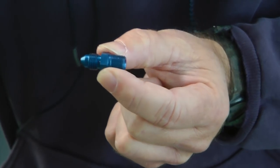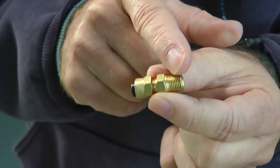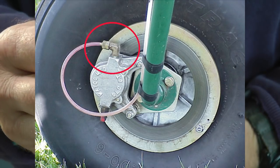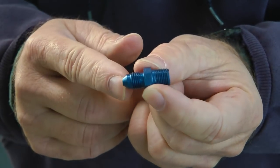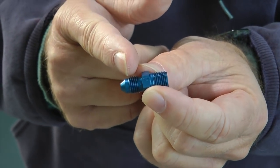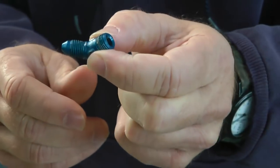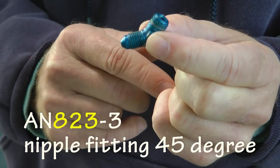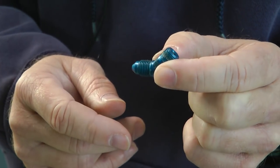The AN816 takes the place of plastic fittings — it has 1/8-inch NPT into the master cylinder or caliper where the plastic line previously connected. If we want to exit the cylinder at an angle, there's the AN823, which is 45 degrees: 1/8-inch NPT on one side and dash-3 flare on the other. For a 90-degree exit, we use the AN822. It just depends whether you want straight, 45 degrees, or 90 degrees coming out of your cylinders or calipers.